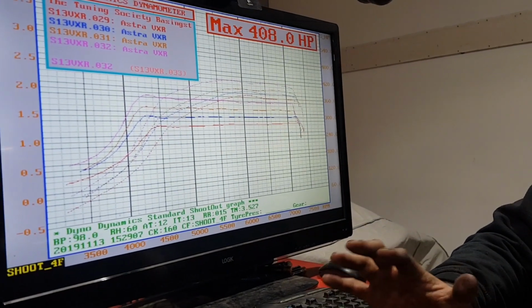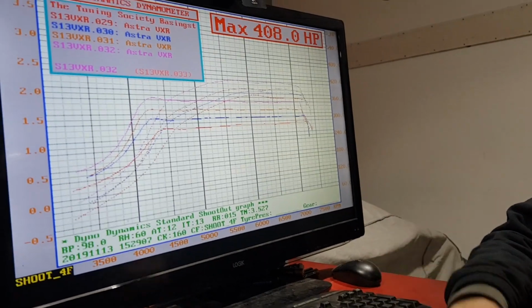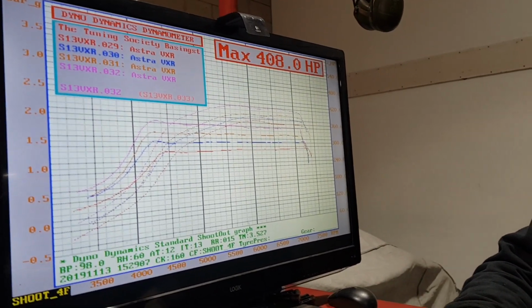When you use screamers, it's like having a larger exhaust, because the 3-inch exhaust only has to deal with what's in the turbine housing coming out the turbo, not the entire engine exhaust flow. So that's the flow side of it. There's definitely less airflow. The second side of it is 97 RON fuel. We're just not getting it.